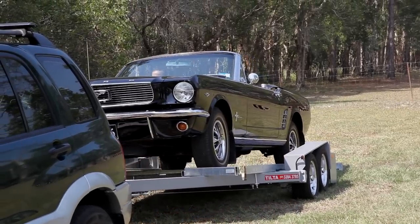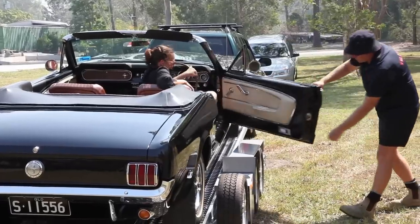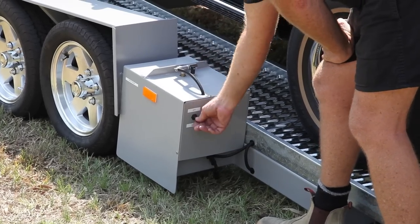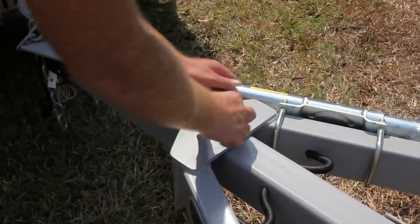Leave your car in gear or park and apply the handbrake. You can now carefully get out of the car using the trailer's mudguard as a step. Close the air valve and turn on the compressor to re-inflate the airbags. Replace the linchpin once the trailer has reached its correct height.